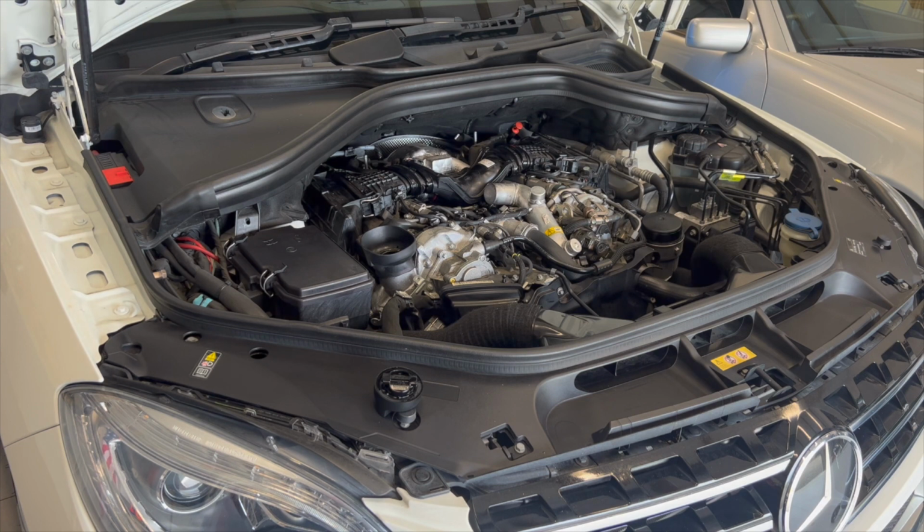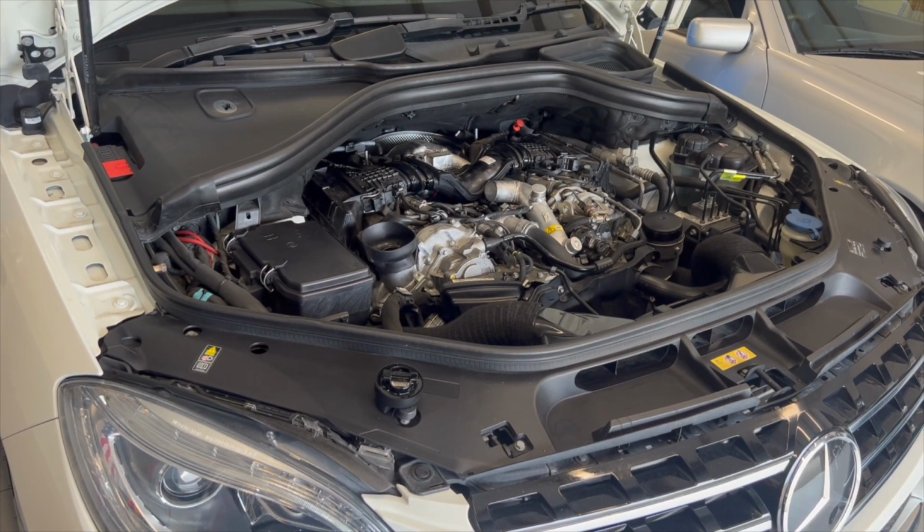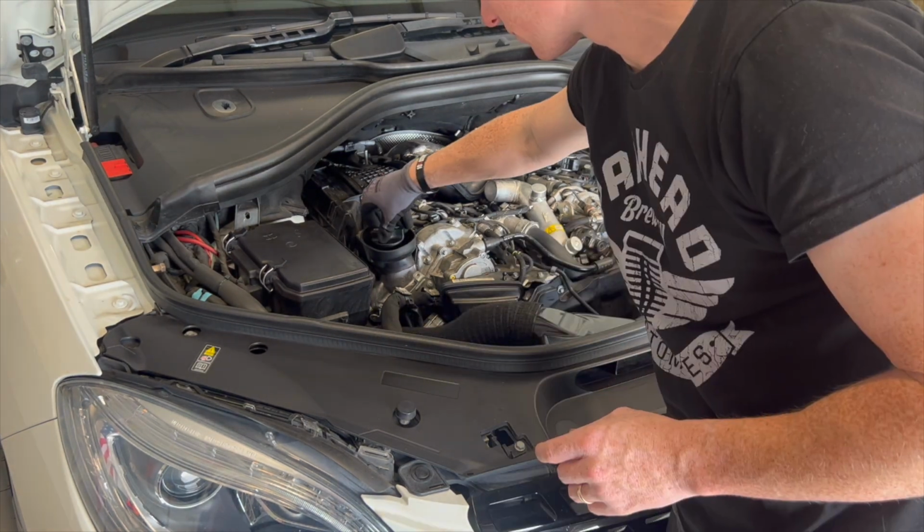We've probably ended up putting about 8.2 litres in total. The refill level is supposed to be 8.5, but as I say, we haven't actually drained 8.5 from it, so we're not going to fill it up more than 8.5. Yeah, it's simple, it's done. So now we just need to put our oil cap back on.